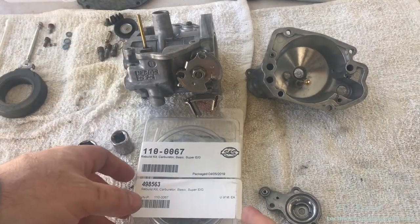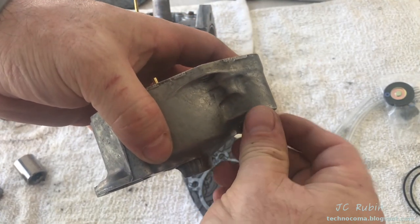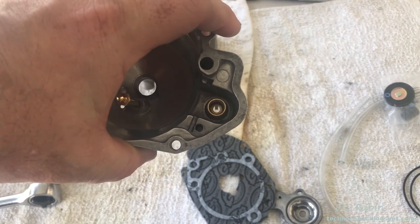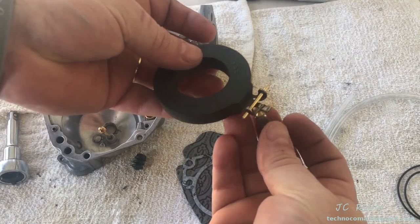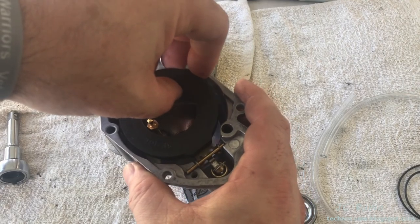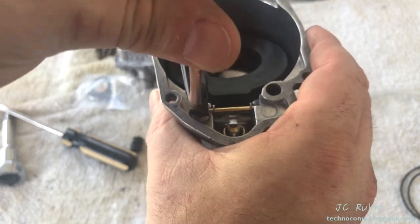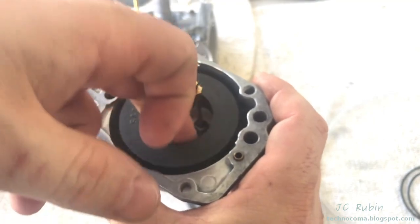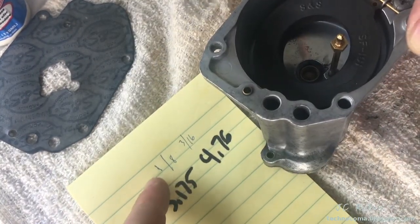I've got all the clean parts on the table and we're going to get right into reassembly. I'm going to open up this rebuild kit — I've lubricated the seal and I'm going to put this back into the float bowl now. I'll screw it in by hand and then tighten it with the ratchet. I pulled from the bag the new needle, grab the rod that was cleaned up and put it through. Hang the new needle on and drop it into place. Get our set screw, snug it slightly. Check if it sticks like before — and it does not. Nice and smooth — perfect.